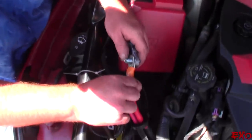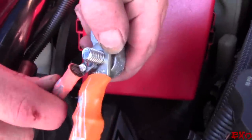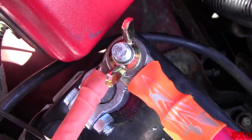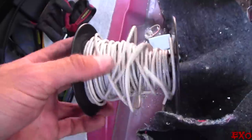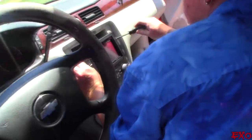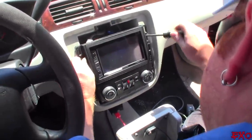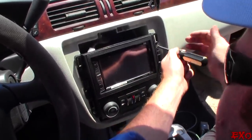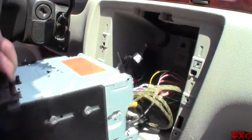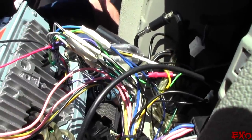Time to put that new snazzy battery terminal on there with our new beautiful heat-shrink connections. She's all installed. Now we just need to run this simple little remote wire — some primary 18 gauge — into the back where all the amplifiers will be. So he's taking out the bezel and the kit holding in the Pioneer double-DIN. The remote should be a blue wire just on the opposite side, so we're going to splice into that little baby blue wire for our amplifier. Pulling it right through — we got a whole roll to work with.